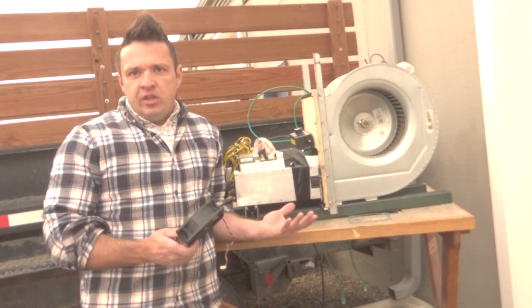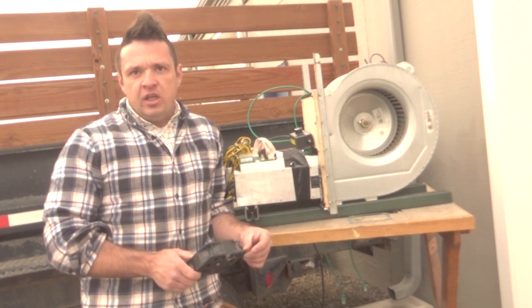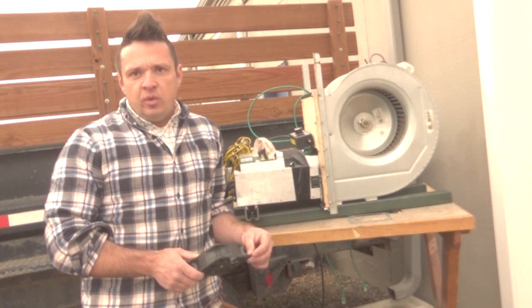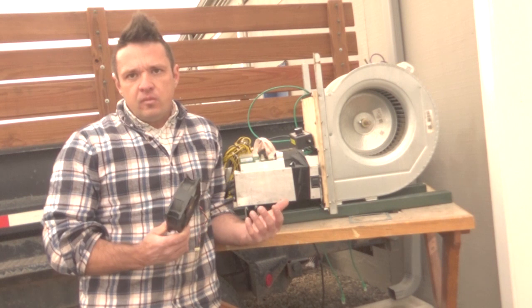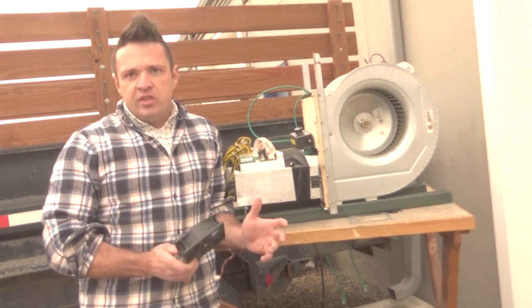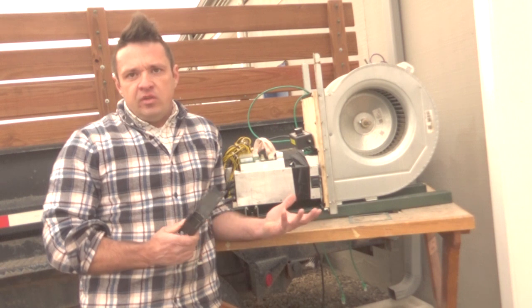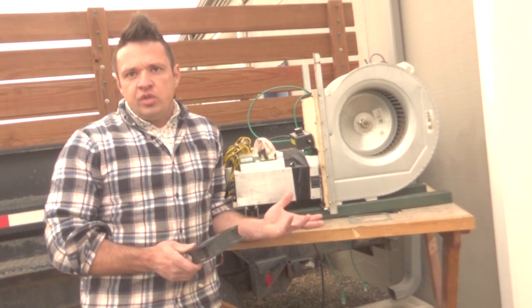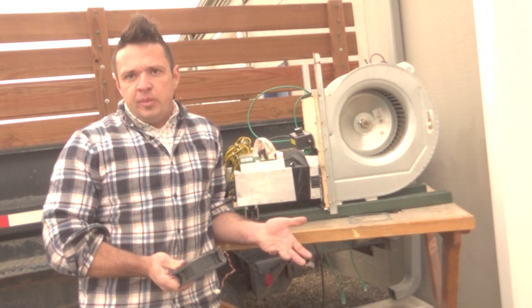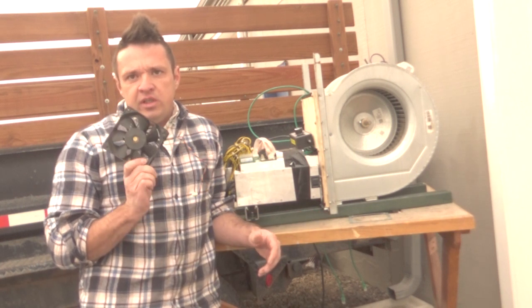During operational testing, this setup ran in an environment with an ambient temperature of approximately 72 to 75 degrees Fahrenheit. The two miners running Brains OS each consumed about 1,480 watts, or roughly 2,900 watts for the pair. They ran at a steady 16 terahashes, with chip temps in the low 70s Celsius — sometimes the high 60s — and board temps around 50 degrees Celsius. This blower at that speed setting consumes 1.6 amperes, which translates to approximately 180 watts, versus the four original fans which would have consumed approximately 150 watts.